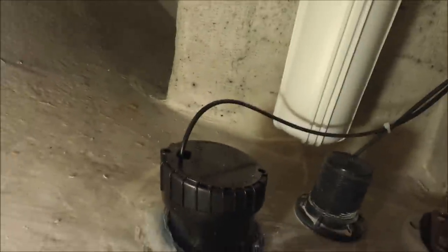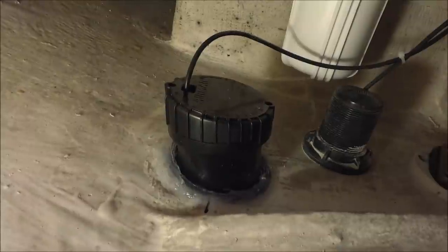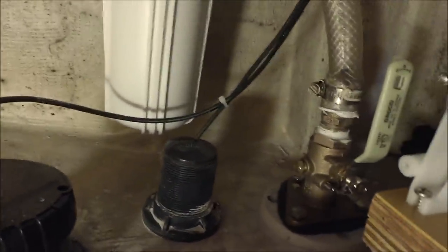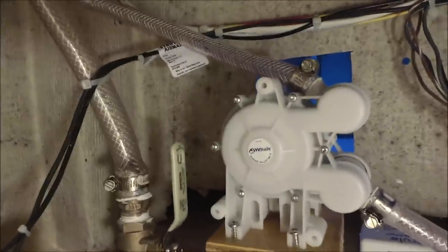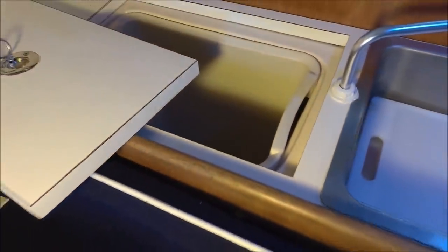Under the forward end of the settee we've got the foot pump, the float switch for the bilge pump, and the bilge pump itself just barely fits in that tiny bilge. Here's where all the wiring had to come out. There's an inside-mounted Airmar depth sounder transducer with antifreeze in it — doesn't require a hole through the hull. The original through-hull transducer is still installed, and we put in a three-quarter-inch seacock to drain the sink and a household-type water filter. There's a lift-out plastic trash can that goes in that locker — quite convenient.